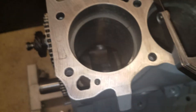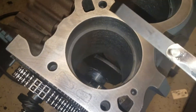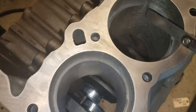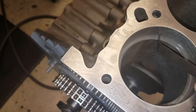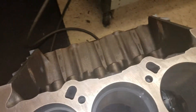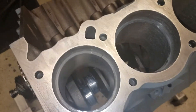I got the rings in number one and number three. I usually just use a piston and push them down evenly on both sides — they make a special tool for that, I don't have one. I've already measured these and they come out right about 18 thousandths, which is great. Factory spec is 10 to 20 thousandths and the general rule of thumb is 4 thousandths per inch. So with a 3.8-inch bore we'd be at 20 thousandths on a four-inch bore. That varies too based on intended use — this guy's not going to run 30 pounds of boost, so I'm definitely safe at 18 thousandths.